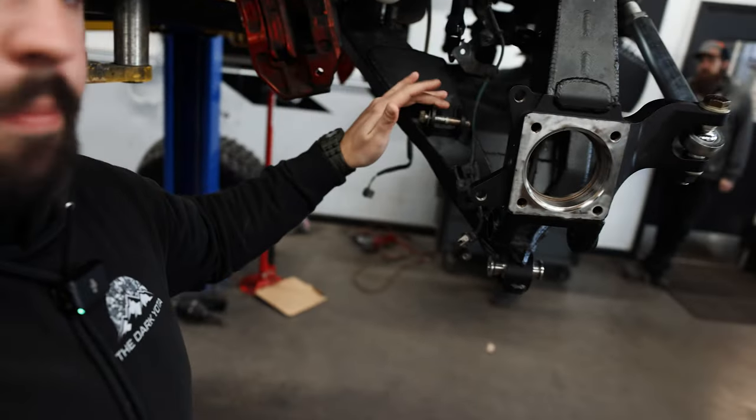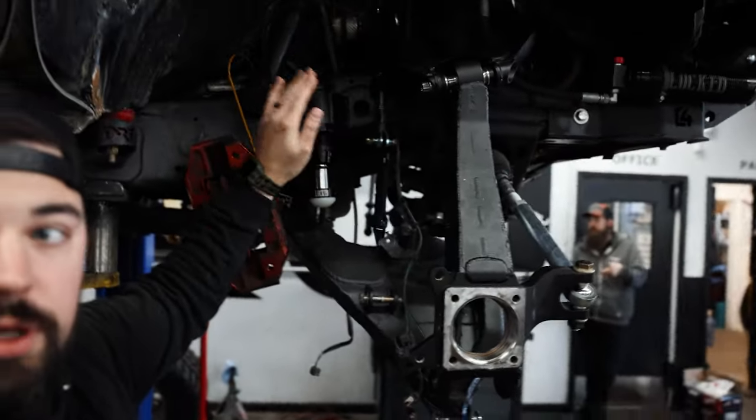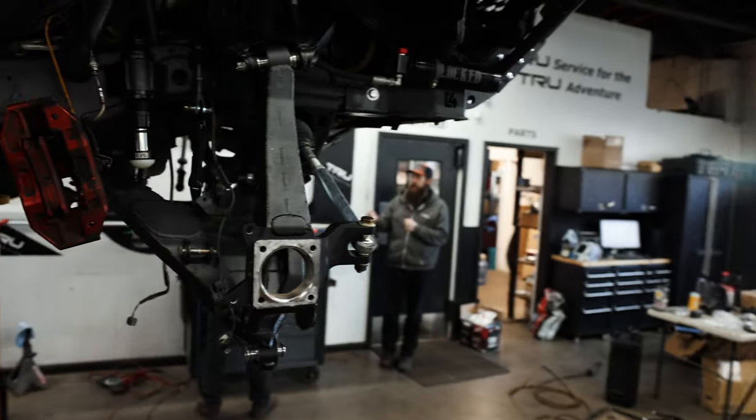All right, guys, it's been a couple days. Joel is now working on the truck, so he's got the bypass tabs, limit strap tabs all welded in, the locked off-road threaded hydro bumps welded in, as well as the limit straps themselves welded in, and now we're gonna put some springs on the locked coilovers and start getting everything kind of put back together. Sorry if I sound like crap. I've been sick the last couple days, but it's coming along really, really nicely, as you can see.